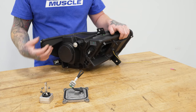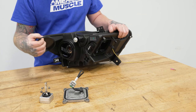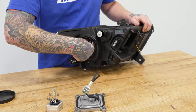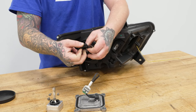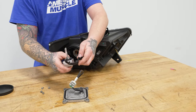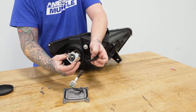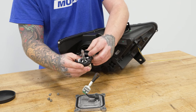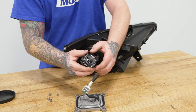Now come to the new setup. We're going to remove the bulb cover, which on these is just a rubber slip cover — just pop that right off. You'll notice it has a new retainer ring in it, so give that a grab and a turn counterclockwise, then pull it out. Push down on the clip to open it up, and get the retainer ring onto our bulb. Your bulb has a couple of little slots or indents — slide the ring on, start to get it lined up, move it around a bit if needed, and once it's lined up, snap it into place.